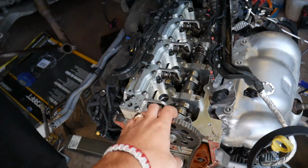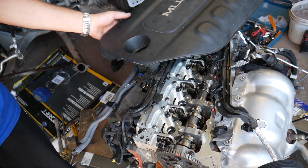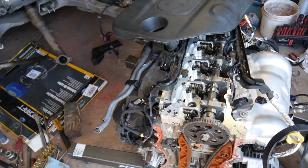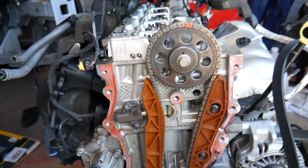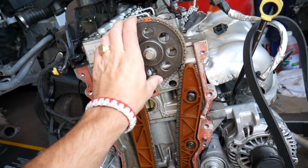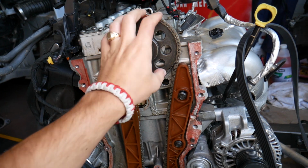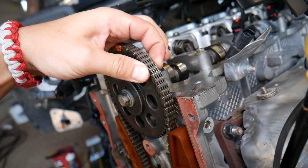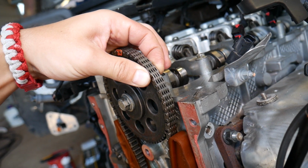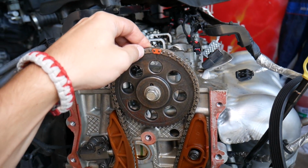You have variable timing on each cylinder on the valves on the intake side, so you do not have an intake camshaft. It uses the exhaust camshaft actually. So practically your timing chain is very short. You do not have the double overhead cam. With the chain being short and pretty thick, you think, okay, I don't need to replace it, and you probably are right. The possibility for that to wear is very minimal.